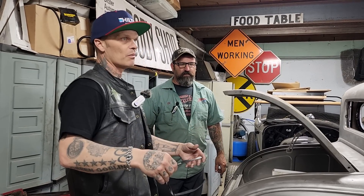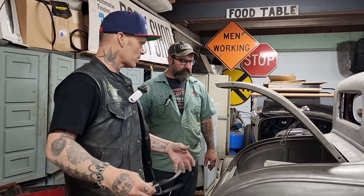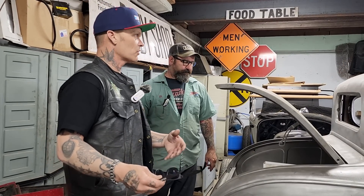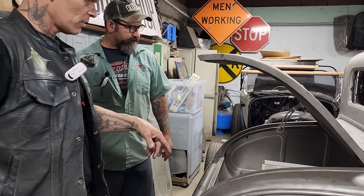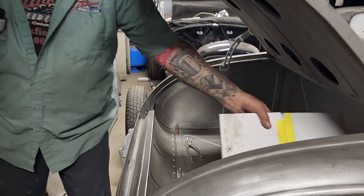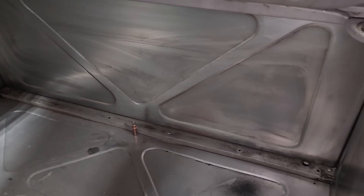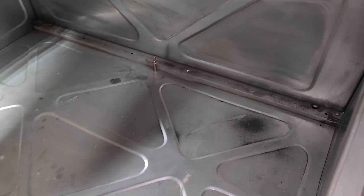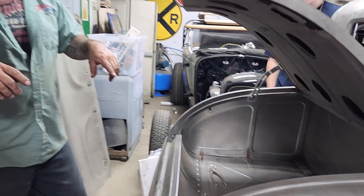The reason is that when you put metal through the bead roller, you're stretching it, and it kind of goes wavy. So in order to make a nice panel, sometimes you have to pre-stretch it and then bead roll it. You run it through the English wheel on light pressure — not a lot, you don't want to warp the panel — just a little bit of pressure in the opposite direction you're going to do the embossing, and then...